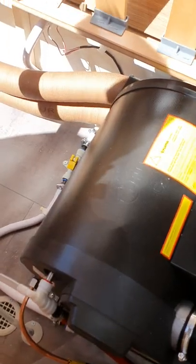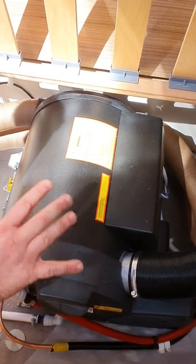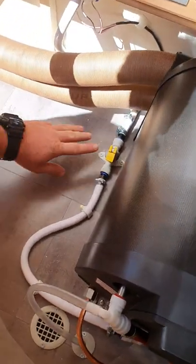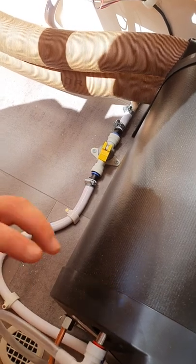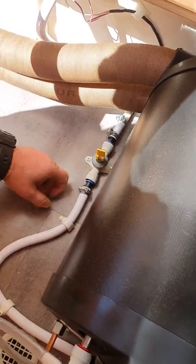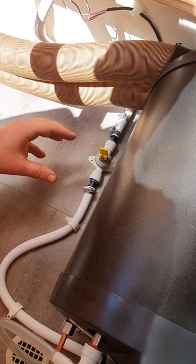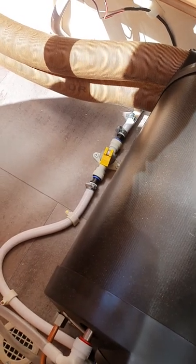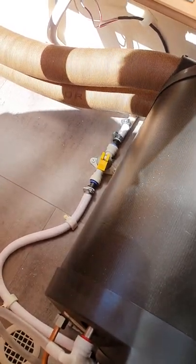The seat beside the kitchen bench is the actual combi boiler unit — this does your water and room heating and largely looks after itself. The one thing to know is a little switch inside: when storing the van long-term, especially over winter, flip that switch up to drain all the water in the boiler out through the overflow. When you use the van again, make sure it's back down — otherwise turning the pump on will just pump everything out the overflow.